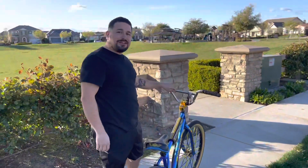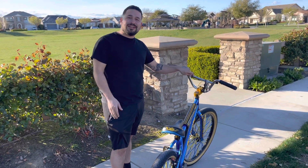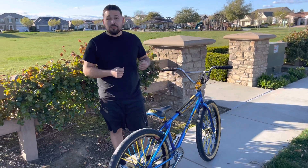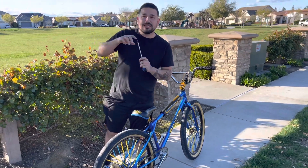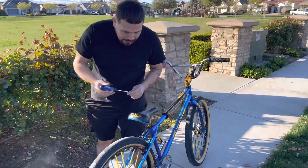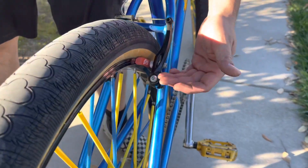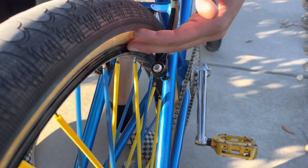Luckily here it's really close to adjustment — the wheel's not rubbing, or only slightly, and we're going to let that wear in properly. Spin the wheel and make sure it's not rubbing. If it is rubbing, grab your screwdriver — whatever side it's rubbing on, tighten it and it should back it out, or vice versa, loosen it and it should go in.